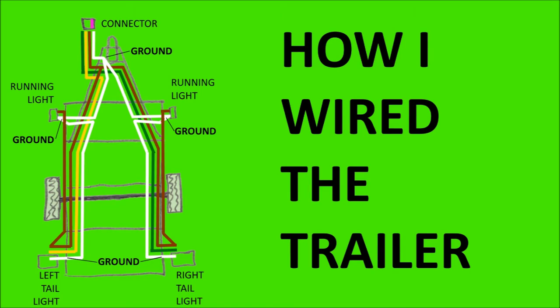Okay, this drawing shows how I chose to wire the trailer. I have ground connections at all the same points, but they're also tied together with copper wire. This is not the way I would choose to do it. Once I was done, I realized that it made a nasty mess up at the neck of the trailer. So I think I would do it differently a second time.